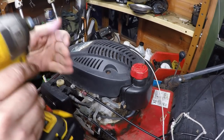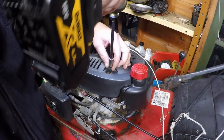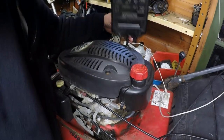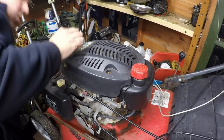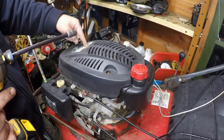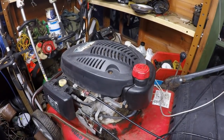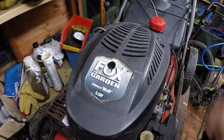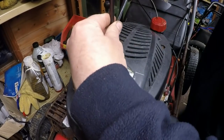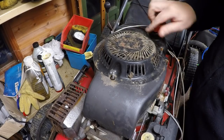So the first thing we're going to do is remove this top cover to get at the pull cord assembly. There are two bolts on the side here, and there seems to be some kind of clip assembly on the front — could be a screw hidden behind this sticker, which there is. There's a little tiny hole just here, so I'll make a hole with my Stanley knife just to get it open. I always find it easier because when you go to resell it, it's still got the original sticker on it. There's a little 10mm in there as well that's got to come off. I've got so much debris in here to clean off.